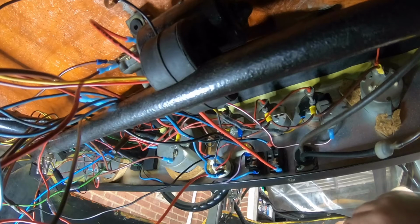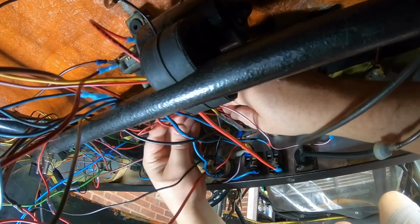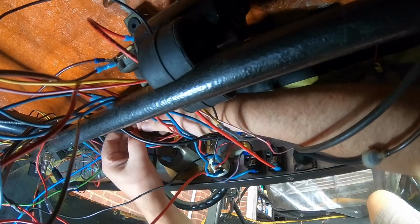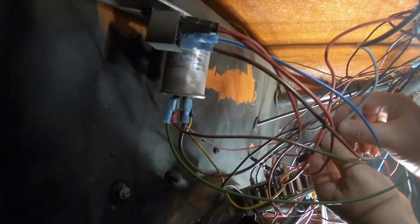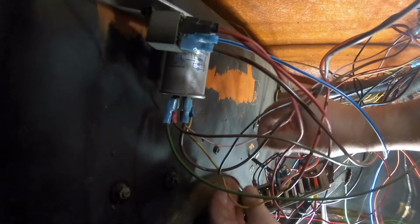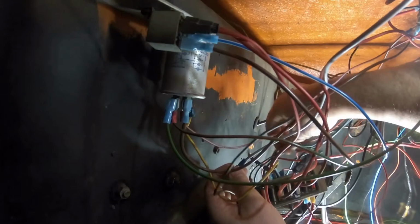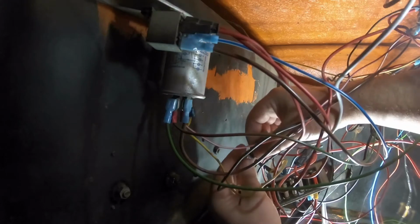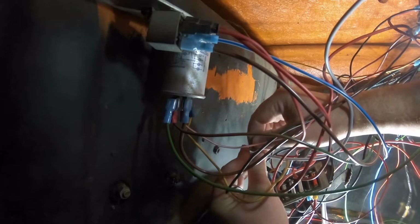Welcome to the back of my dashboard. So I've replaced a lot of the wires, run some new ground leads. I just want to start tidying up these different bits. Side lights going in, grey. The grey for the side light switch, coming across to the fuse board that I removed. It's connected up to a little black wire here, which goes through the bulkhead to the front of the car, which I presume is the feed for the side lights on the front.